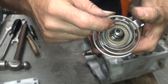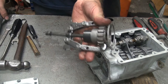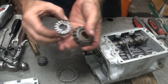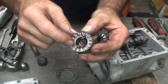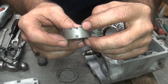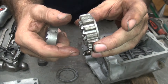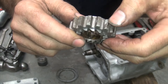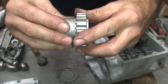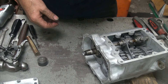You can see all the grease and sand, the leftover blasting, old crap. It's tight on the shaft and not letting it come off. There's our kicker gear — this is an original style one with the old two keys in there, which you rarely see anymore. The kicker dogs are worn a little bit on the side, but they're still functioning. These teeth here still look good too, so this looks like a still usable kicker gear. The teeth are getting pretty worn right here though. It could still be used, but I'm going to build a hot rod motor so I'm going to put new parts in there. I don't want to break my knee when I'm trying to kick a big inch motor over.